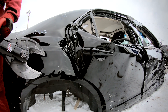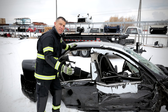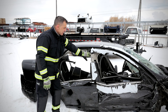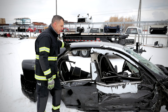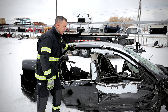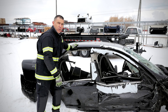We need to keep in mind that 25% of all roadway incident fatalities are from T-bone or side impact accidents. The occupant is generally trapped somewhere in the hip area between the car seat and the B-pillar. We're going to come in with the ram and start it at the back window, moving it in increments forward towards the B-post at the roof line. We do that so that we can stop short to remove the occupant for EMS transport.